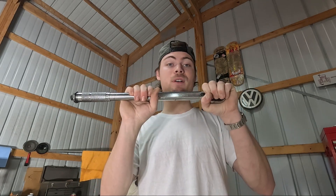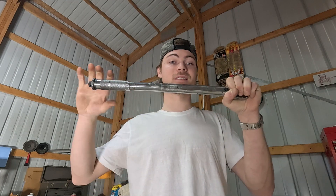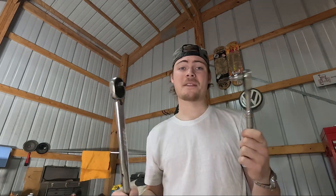If I'm pushing here I'm going to need to put a lot more force to get the same torque as if I'm pushing out here. That matters because not all ratchets or wrenches are the same length. In order to actually know how much torque you're delivering to the bolt, you have to account for each different length ratchet.